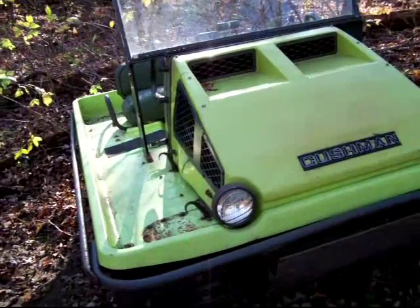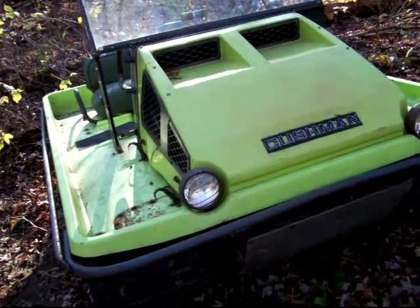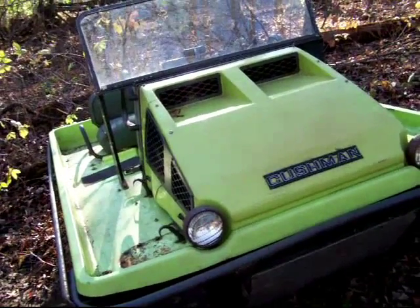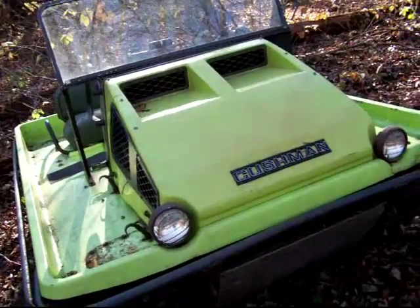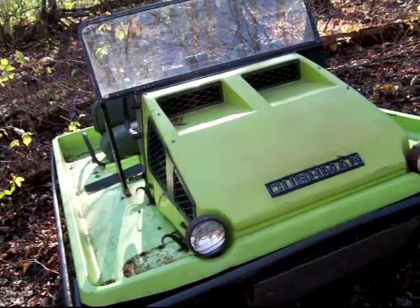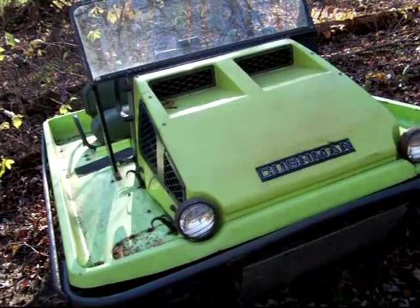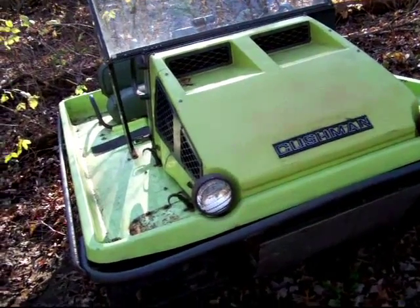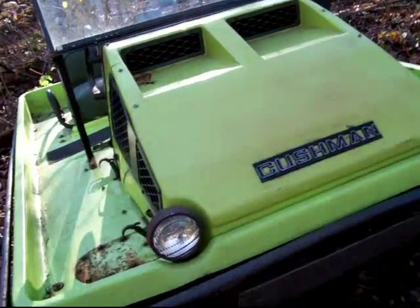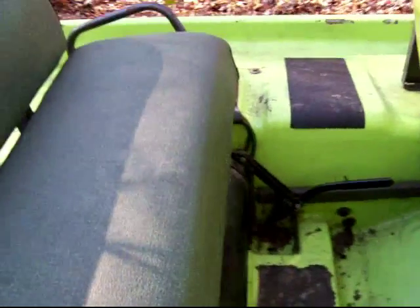and the points wire was showing that when the points were closed, it still had 8 ohms of resistance. So that means some piece of crap got in the points gap, and unfortunately that means pulling the flywheel. So that's what I'm about to do. I brought a majority of the tools that I need, but I'm going to give some pointers.